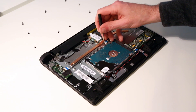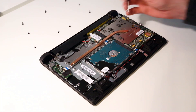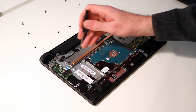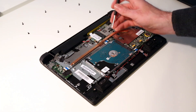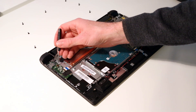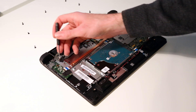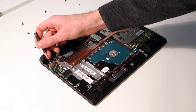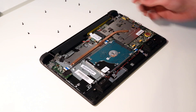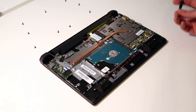The hard drive is held down by three or four screws in its cradle. With that removed, we can also release the keyboard. If there are any issues with the AC adapter, the power board here can be removed with one screw and by disconnecting the ribbon cable. This is also handy if there's any damage to the AC connector — you only have to replace this small board, not the entire main board or do any soldering.